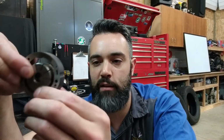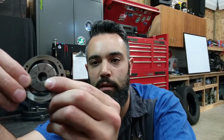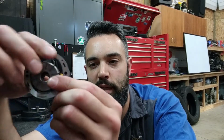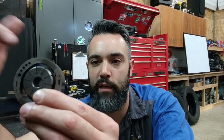We're going back to Pascal's law. We're trying to distribute even pressure undiminished in all directions in a sealed system. If air gets into this pump, air can be compressed. So that's going to cause the pump to have less resistance, and that air is going to be foamed up. That air is going to be compressed. That's going to generate more heat. There's going to be starvation of fluid to cool and lubricate the friction components and lead to premature wear of the internal parts of the pump body, and the system isn't going to operate correctly.